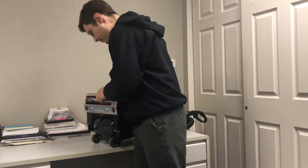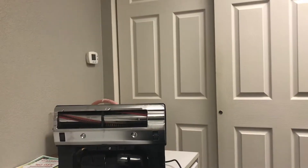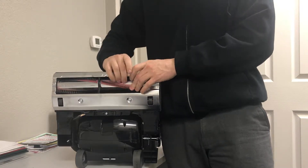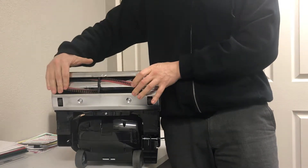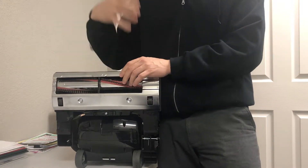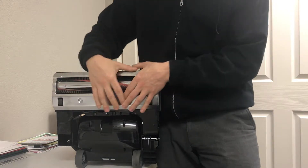Now we're going to look at the brush roller. The brush roller in a vacuum cleaner is what spins to break debris loose off of the floor and then sucks it up into the vacuum chamber. The brush roller turns in the direction of the operator, so the brushes actually rotate towards the person vacuuming. Higher quality brushes are made out of nylon, soft nylon, or horsehair. Lower quality brush rollers are made out of plastic, which is bad for carpet — they'll tear it up and actually void warranties on new carpets.